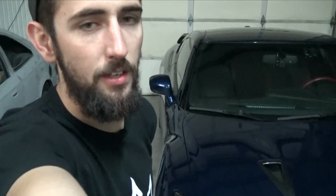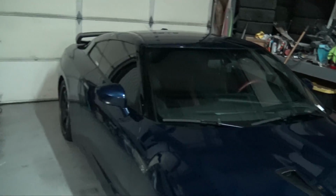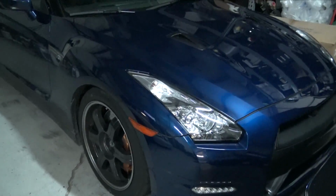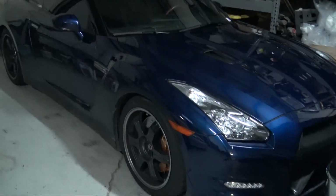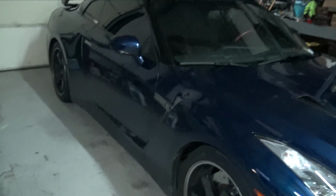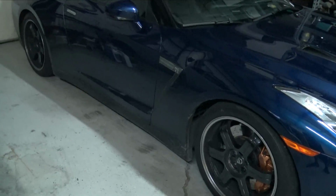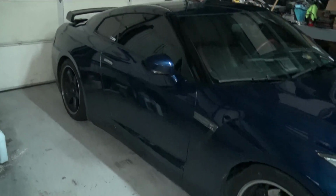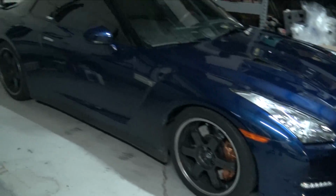He's like, oh, they're doing the drag racing up there, and I was like, yeah. He's like, take the GTR, and I was like, really? And he's like, yeah. I was like, what if it breaks? And he's like, oh, then it breaks. So I think he's almost waiting for an excuse for it to break so he could build it more. But I think the next upgrade is going to be injectors, E85, and fuel pumps, and do an E85 tune on it. Then eventually I think he wants to build the tranny, upgrade the turbos, maybe even forge the bottom end and go super crazy with it.